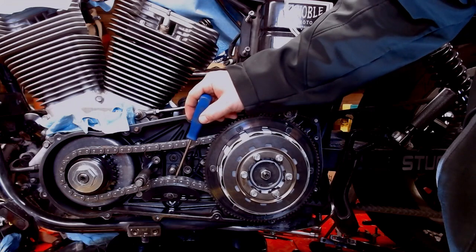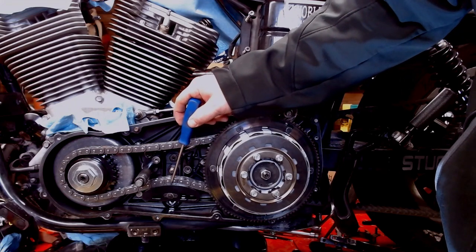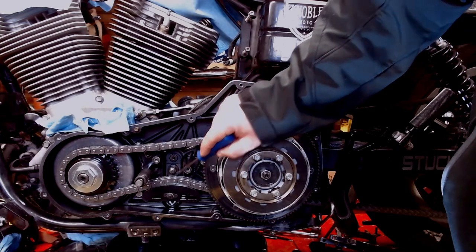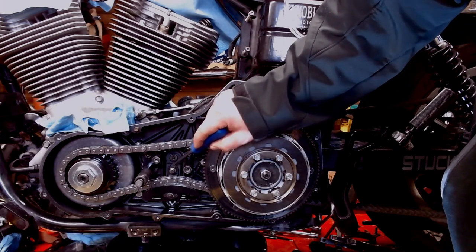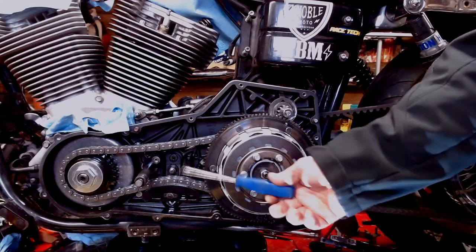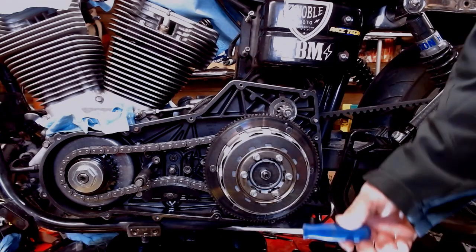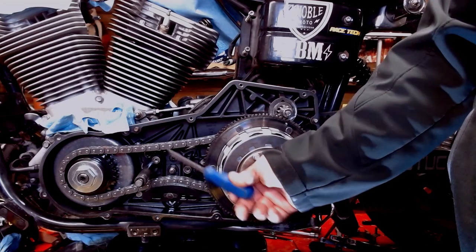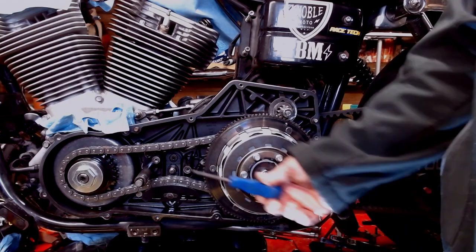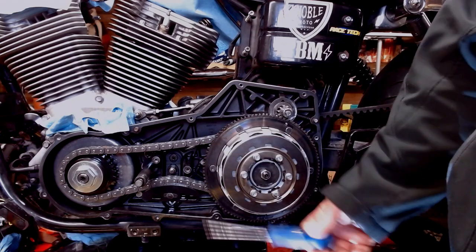Our primary chain tension is on this little puck down here, and that takes up all the extra slop up in here, and that is mounted to this multi-spline back plate back here. Now there are a lot of different little automatic tensioners out there. I think the stock setup is pretty solid even though I got to come in here every 27,000 miles and make one little click of adjustment. Big whoop.